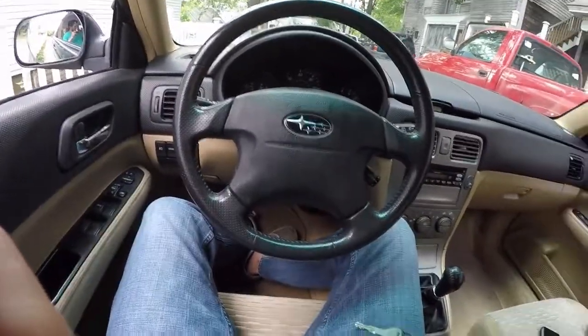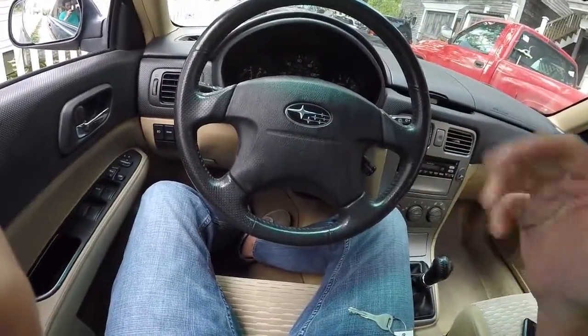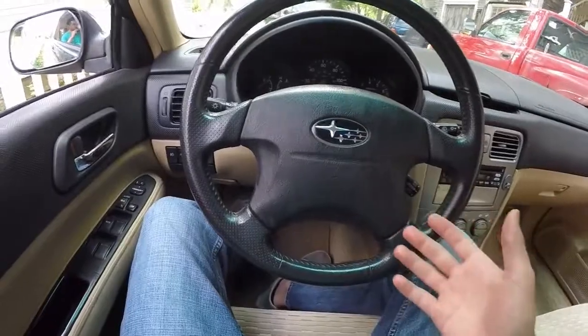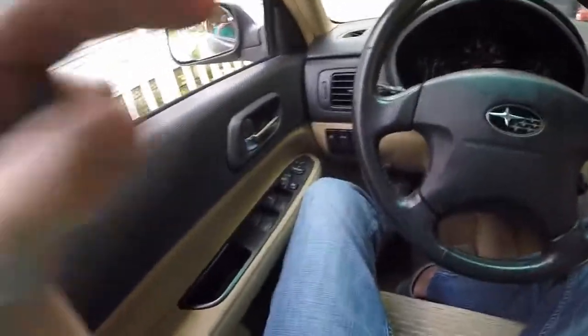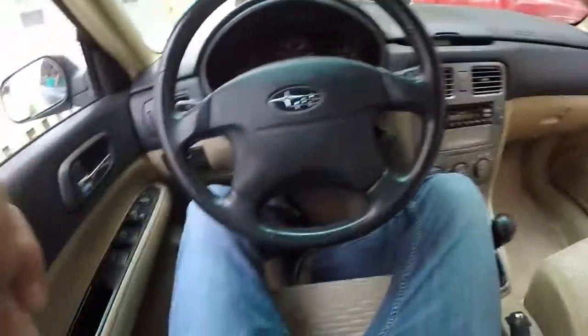What you've got to do is make sure all the doors are closed to begin with. Unlock all the doors in the vehicle. The rear hatch or trunk has to be closed as well. If you have a manual transmission car, you open and close the driver's side door while all the doors in the vehicle are unlocked.